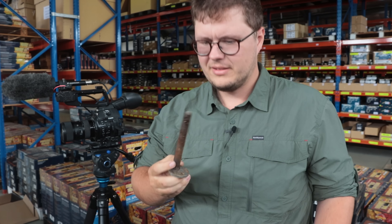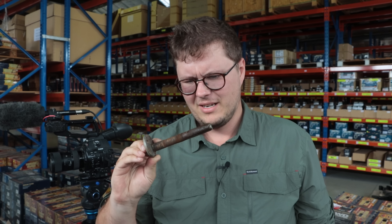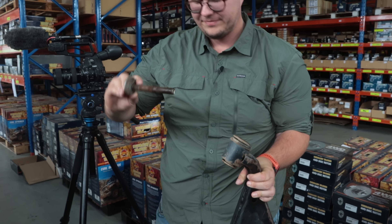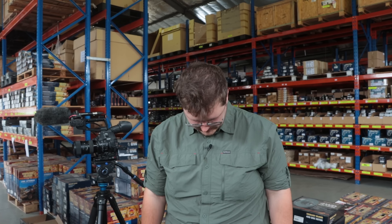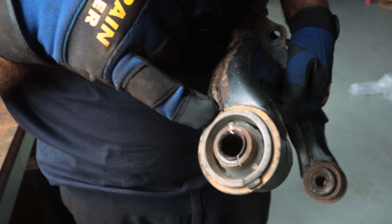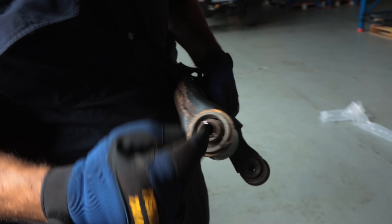This is not good - look how disgusting this is. This was to do my wheel alignment and this actually holds the entire lower control arm. The bushings are not great at all - it's all going to have to get replaced. It's just going to end up putting more strain on everything else and we're not going to be able to align the wheels properly. So it's time. Look how it's cracked - you don't see that until you really get in there and look.